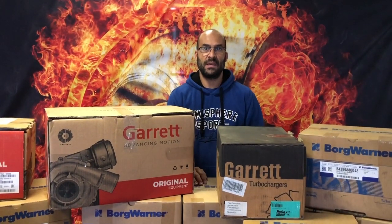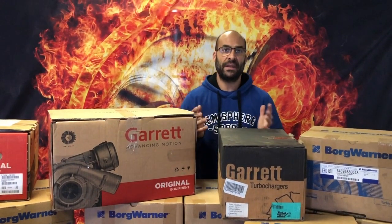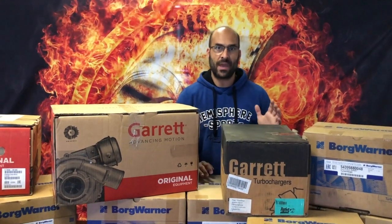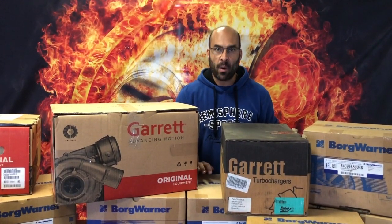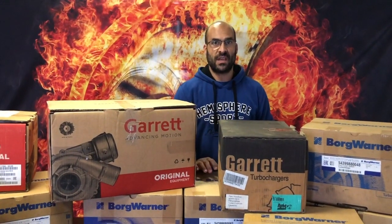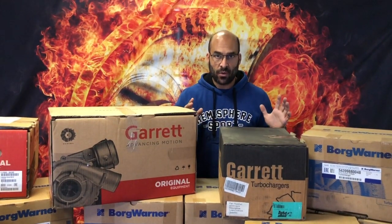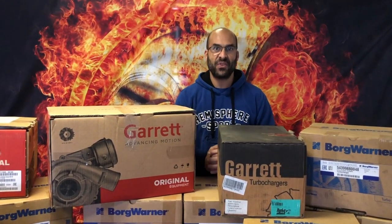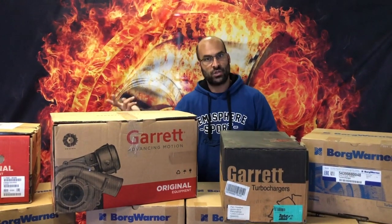This video is not going to be about performance or anything of that matter. What we're going to do is give you guys an understanding of how part numbers work and the range of part numbers that exist for various OEM engine manufacturers. For example, all these turbos on the table fit the same power plant — the VW 1.9 TDI. One or two will also fit the two litre TDI. In total on the VW range, there are more than 30 different variants that fit the same 1.9 TDI or two litre TDI engine.